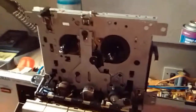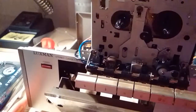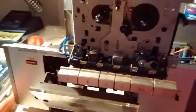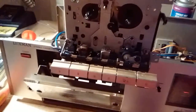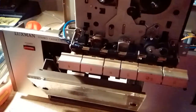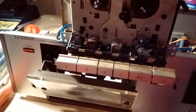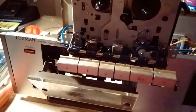Hello again everybody. I'm back with a Luxman K205 cassette deck in pretty decent shape. It needed the usual stuff for a deck made around 1984 to 86 — it needed to be cleaned and lubricated. The heads especially were pretty filthy. Once they get to that point, a lot of people just throw them out, not realizing that if you clean them, give them a good cleaning and demagnetize the heads, they sound really, really good.